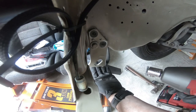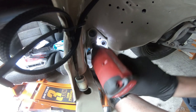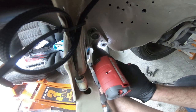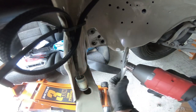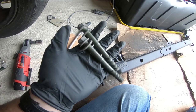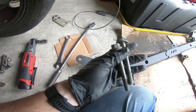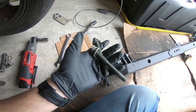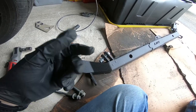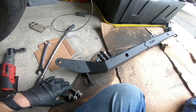I'm going to gently take the actual tow hook and pull towards me. It already came out more now, still not out all the way. The tow hook is off. Here's the original bolt you pulled out of the crossmember — there were two on the left side, two on the right side. You're going to reuse these to put the crossmember back up. You can lift it back up with a jack, slot them in, hand-tighten them at first. It's not that heavy, so I'm just going to pick it up by hand.